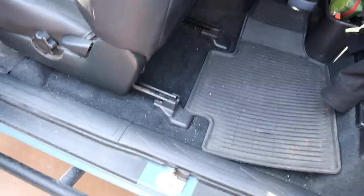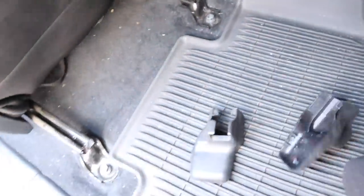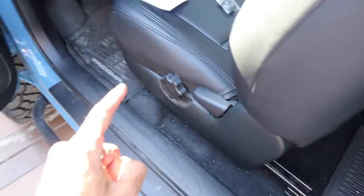Let's just ignore how dirty inside of here is. I apologize in advance, but we can take these rear seat covers off — these just honestly rip off. It is dirty in here; good thing for me to vacuum. Then we can grab a 14 millimeter and take off all four bolts. I'm going to loosen the back and remove the front.